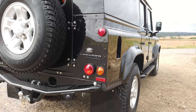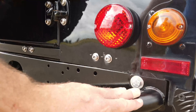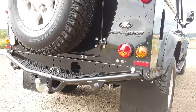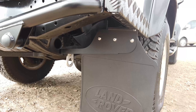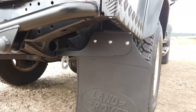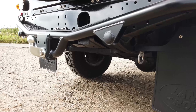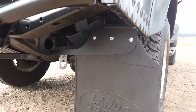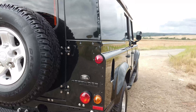To the back end — this is a genuine Land Rover NAS rear step. It had the usual slight bits of corrosion on the edges, so we took it back, stripped it down, shot blasted it, and it's been fully re-powder coated and treated inside, so it should last a very long time. New rear mudflap brackets fitted with stainless steel hangers — they're the same grade strength as steel ones but they just don't rust. All the new bracketry for the cross member has been updated and rust-proofed. Stainless steel mudflap brackets — they'll never break, much stronger, so you'll never see that horrible rusty rear mudflap bracket.